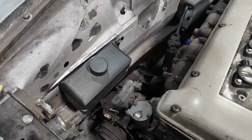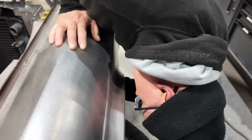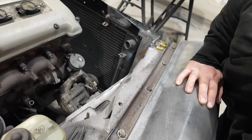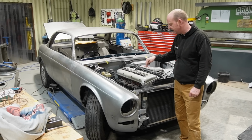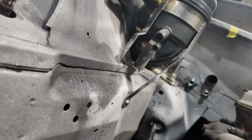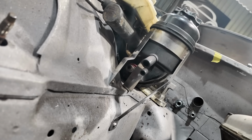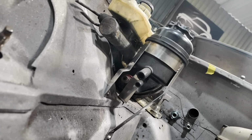We use a tank, we have started using and have on the last few projects tanks from a company called Doga in Spain, who make a lot of OEM screen wash tanks and filler solutions, if you like, for those tanks, flexible necks and things. So we're using a Doga tank in this, and Stu's got that mounted. He's also made a rather nice stainless steel mounting for the power steering header tank, which we're using an ATE type tank for. They're available new and they're a nice tank, just look neat and work. So we're using an ATE tank for the fill on that.